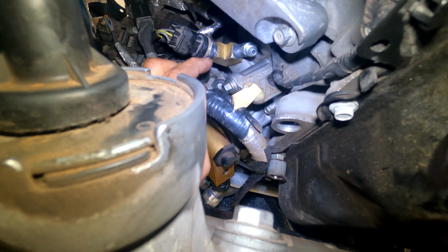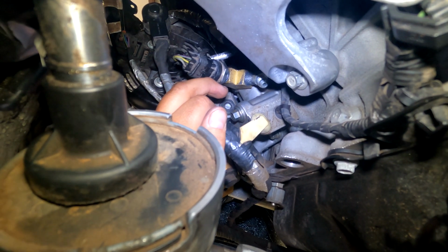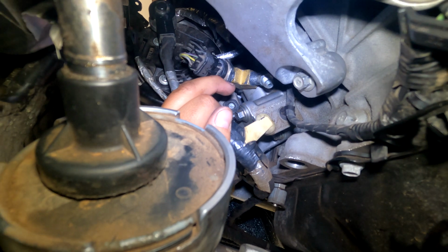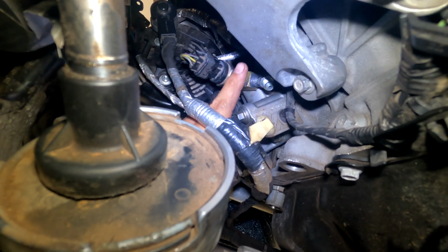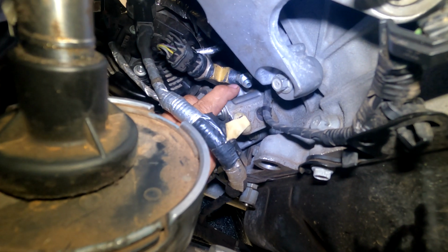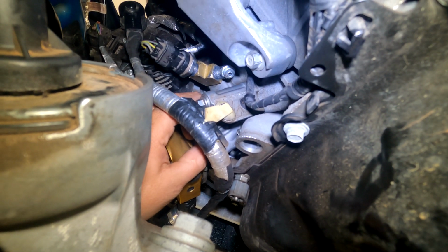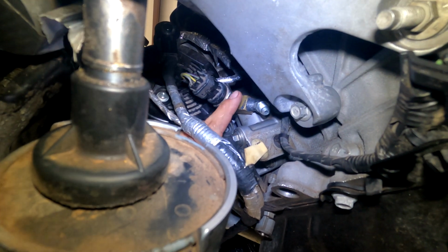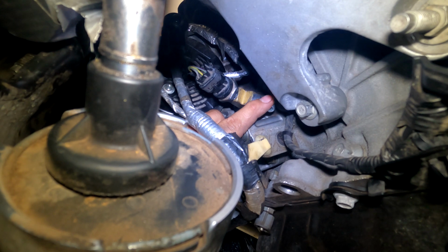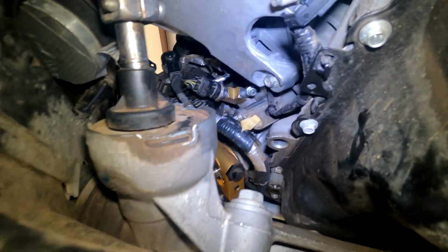It's the oiling system right here. You're gonna screw in the brass fitting after you take out this oil pressure sensor, right? You're gonna screw in this brass T fitting to where it almost feels like it's gonna be tight. Then you face it straight vertical. That way you can get this silver 45-degree fitting. You can only screw this on if this thing is pointed straight up. Then you get it facing the way it needs to get facing, which is like that. And then you have to tighten this and bring this from pointing straight up down to where it's at now. Yeah, that was hard. There's not a whole lot of room in here to do anything.